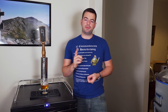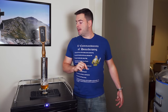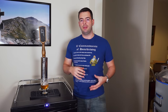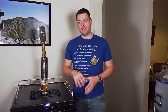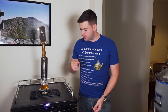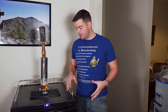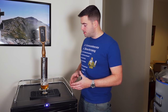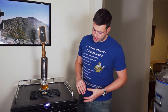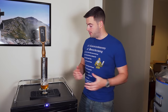That's that piece of wood that runs around the top and the taps are drilled through. I'm going to take that concept, and instead of running taps through it, I'm just going to use it to expand the depth of this kegerator here. So I'm just going to take the door off and run 2x6 around the complete perimeter of the door, and then I'm just going to reattach it so I have expanded capacity to fit 4 kegs in here. And I only need to expand it by about 6 inches or so, and then we should be able to fit 4 kegs without a problem.